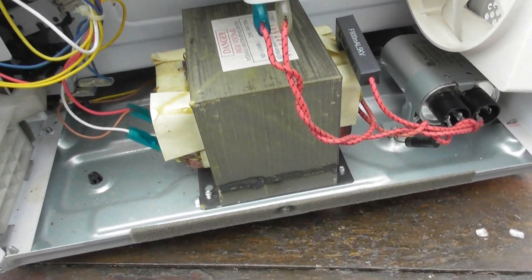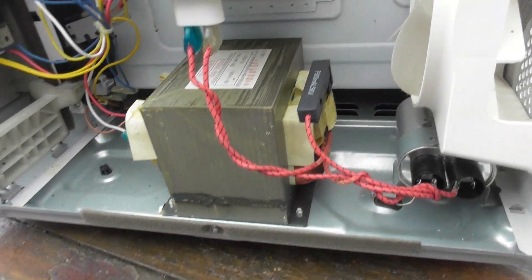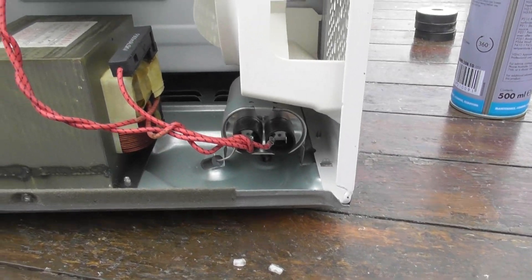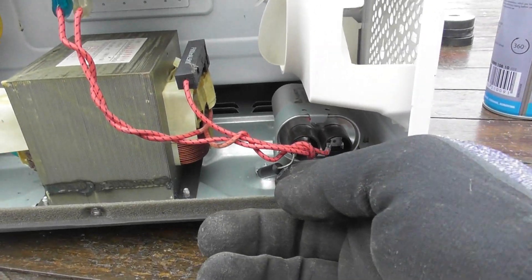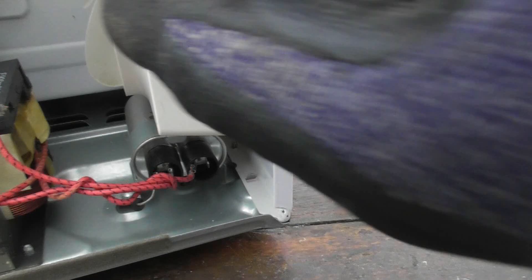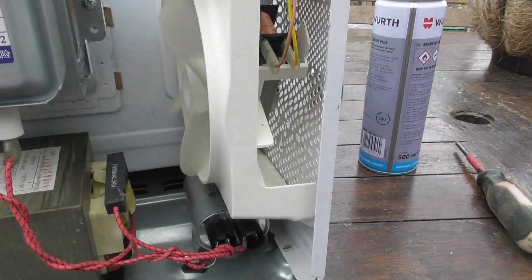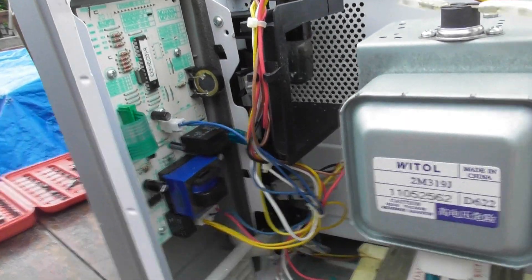That's 230 to 240 volts in, 2200 volts out. Capacitor, resonant circuit. There is a fuse in here. Diode — these can sometimes store a charge, so be careful with that. The cooling fan and there's a shaded pole motor, handy to have. You've got the control board and sometimes you can use the timer if it still works.